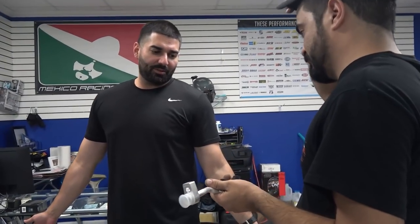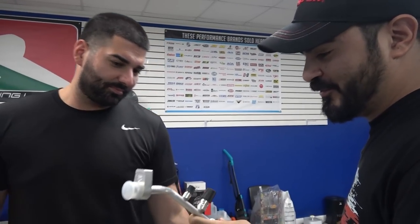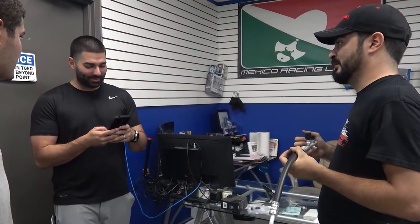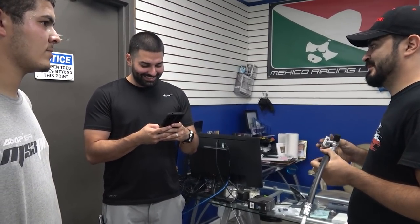What do you mean this guy bought a turbo kit for three grand and everything doesn't fit like it's supposed to? Apparently there was an issue — this kit says it fits your car, but not a 2018 and above. My car identifies as a gen 3. It's still a gen 2 car. We need to find a hydraulic shop around here so they can make a new line — apparently the 2015 through 2017 lines are a little bit shorter and when you put it on this car it doesn't reach the condenser. We've got to figure this out now while it's on this rack.